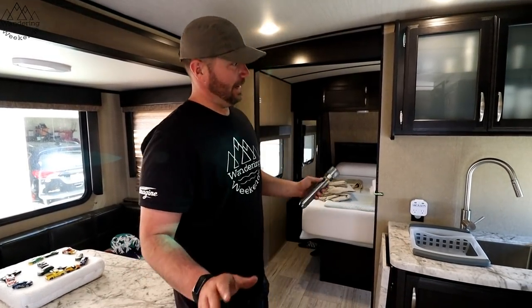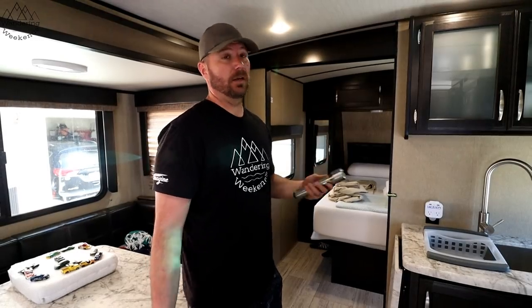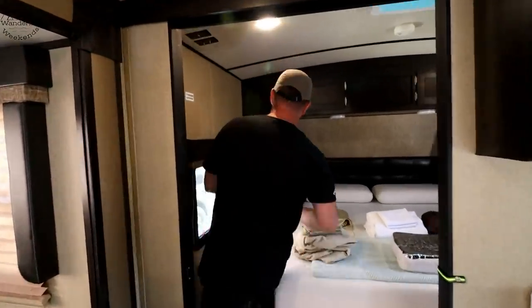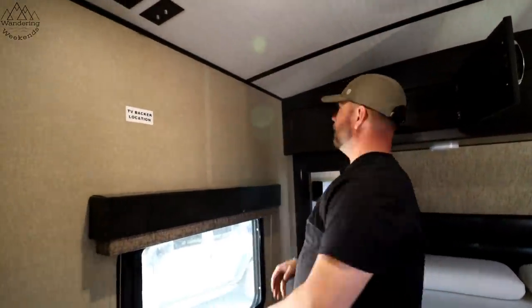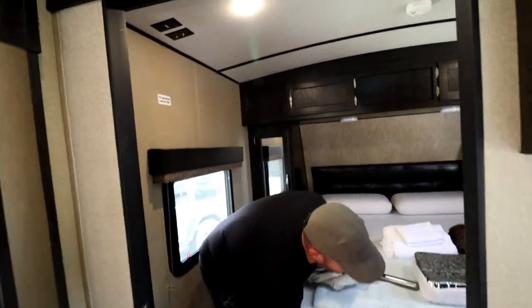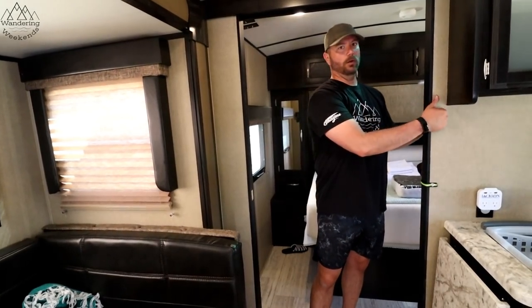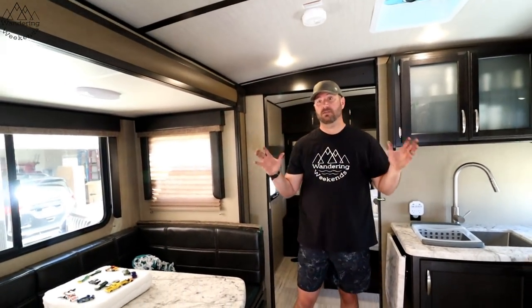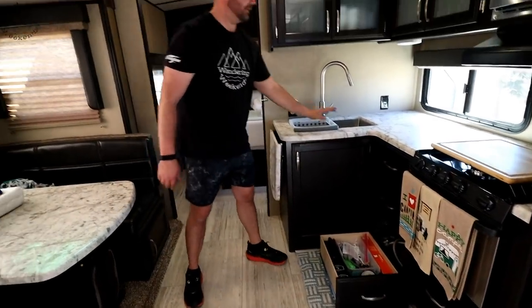Number two on the list, and this one's probably as important as tires: we're going to check for leaks, and while we're checking for leaks we're going to check for pests. This thing's been stored since November and it's now March, so it's been sitting for three or four months. Get up in the corners with a flashlight and look for leaks. As you're looking for leaks, look for pests — get under the bed, make sure there are no big spiders or rat nests. We've been lucky and never had mice, but I'm always expecting them. Be very thorough; I've even waited to de-winterize so I could look behind cabinets for moisture.